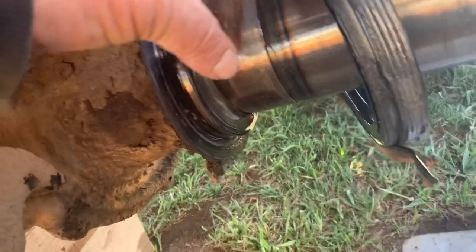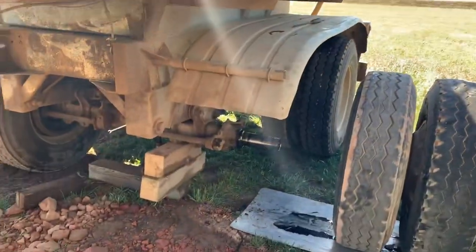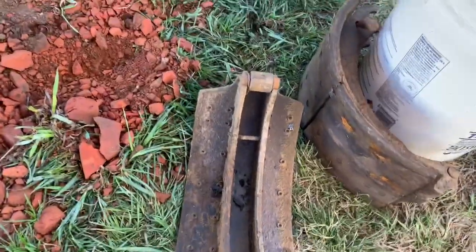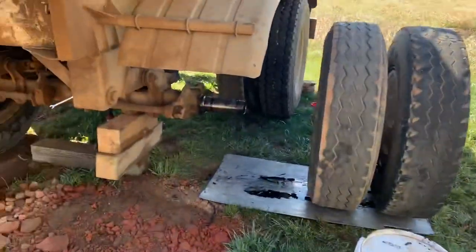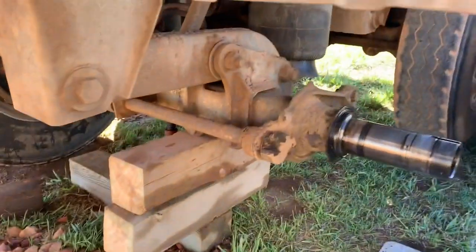The seal just pops right off. You can see it fits right in — that's got to come off; this is pressed on so I'll knock that off. But that seal is the only thing that's keeping the fluid in, so we've got to get this back piece off and go try to find our parts. We're going to get shoes — they want to see the old ones — plus a new axle seal. We can put this thing back together, but that's probably going to be in Part Two because I'm going to spend some time going through the S-cams to make sure everything's working properly.